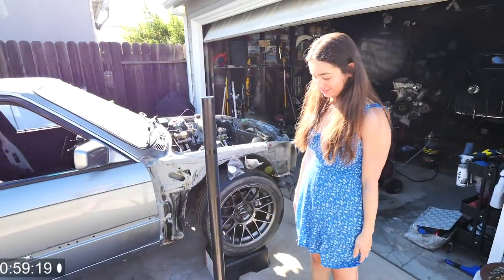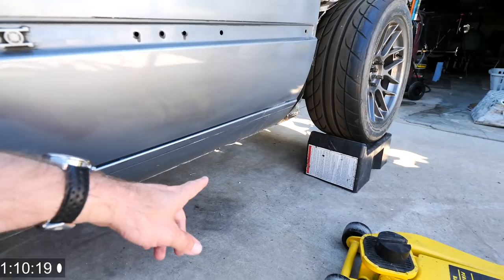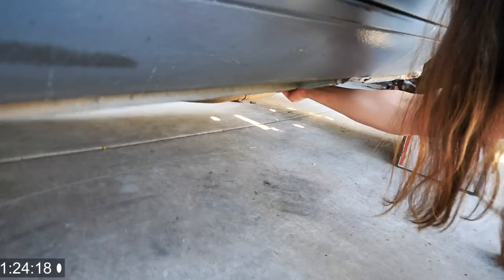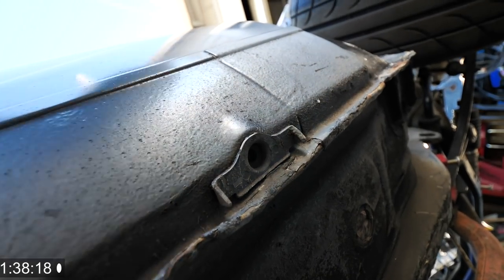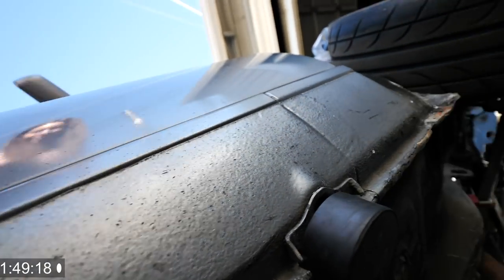So I'm gonna have her jack up the E30 from the proper jacking point. Let's look at this hockey puck thing — if you were to put it under the side of the car, where do you think you'd put it? You could put it down there on the frame rail — yes, exactly. That right there — go ahead and put the puck up to it. See how it fits right in there? It's perfect. You can see that it's made right for this particular jacking point on the car.